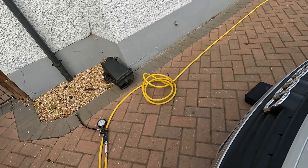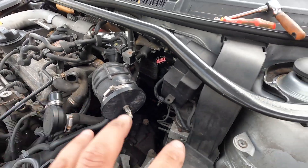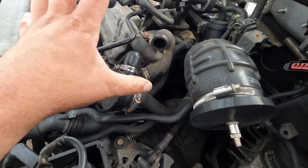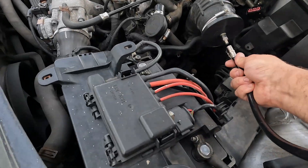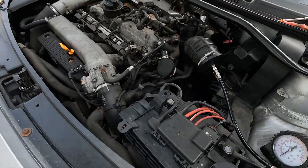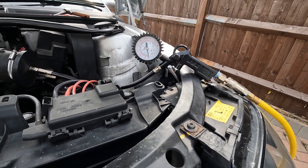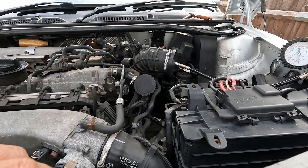Now you're in a position where you've got your airbox removed, MAF removed, the bung plugged in nice and tight — don't go mad because it's quite easy to over-tighten these. We've blocked off the pipe that comes off so we don't over-pressurize the crankcase. Then we're ready to pump it up. I'll go and turn the compressor off because I know it's going to suddenly jump into life. We've already got it set to 20 psi, so we can hold the trigger down and it won't over-pressurize the system.